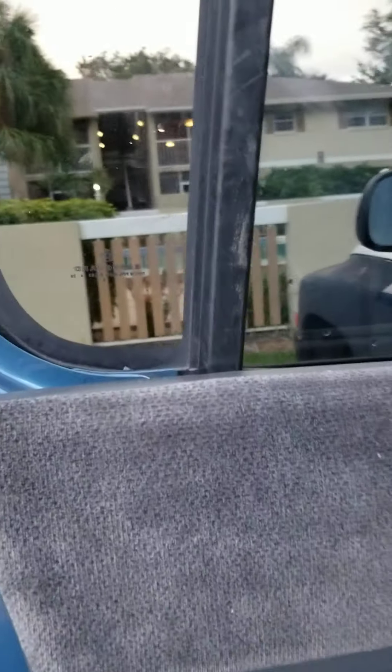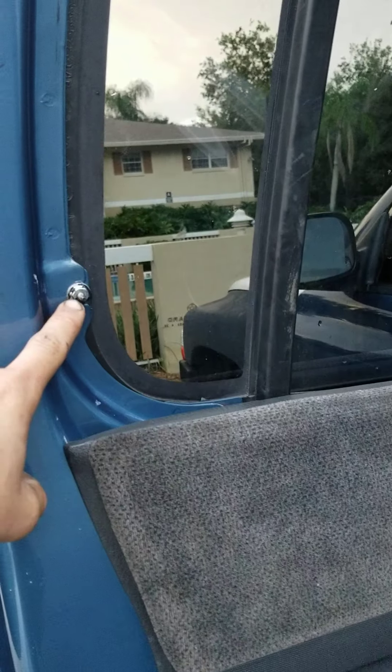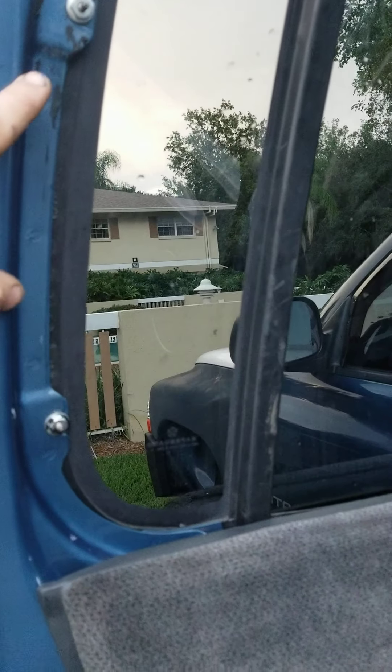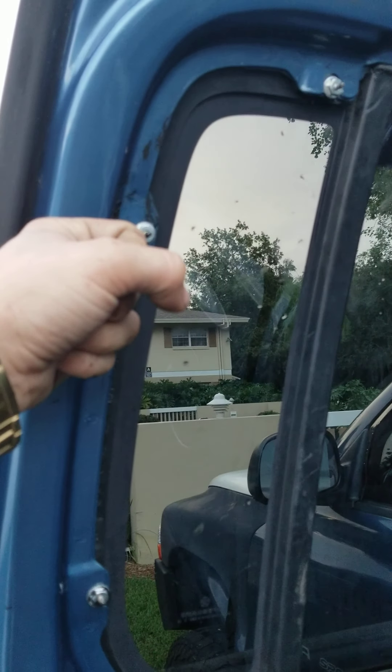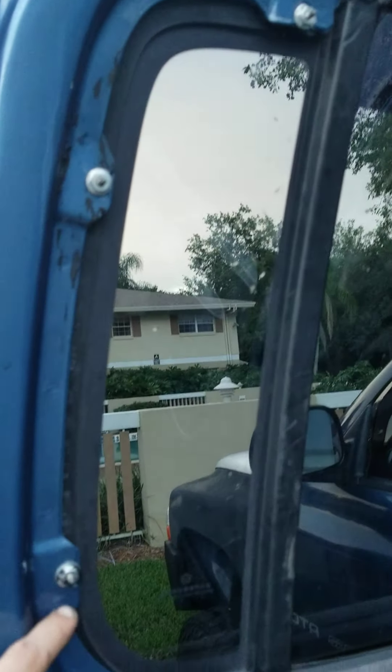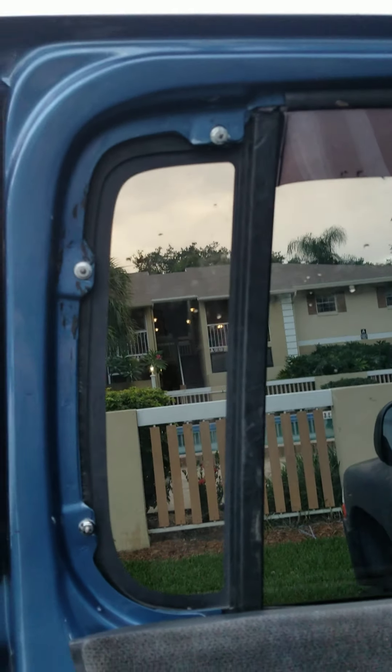At the same time, just remember — if you take this door panel off, you could very easily start bottom to top or middle. I just feel like if you pry the middle off and get to that point where it just kind of pops free, you'll end up snapping these without even meaning to. So I would start top to bottom or bottom to top, however you want to do it.